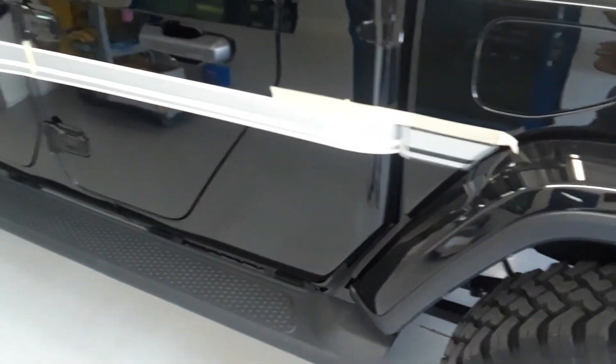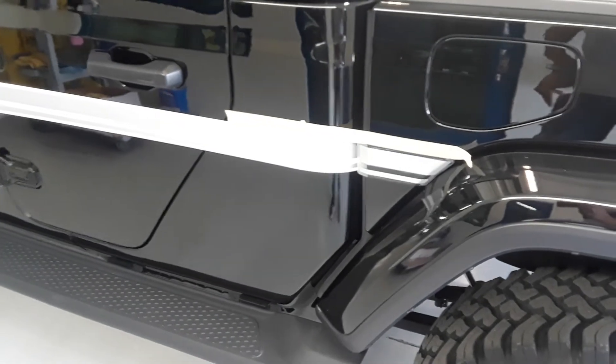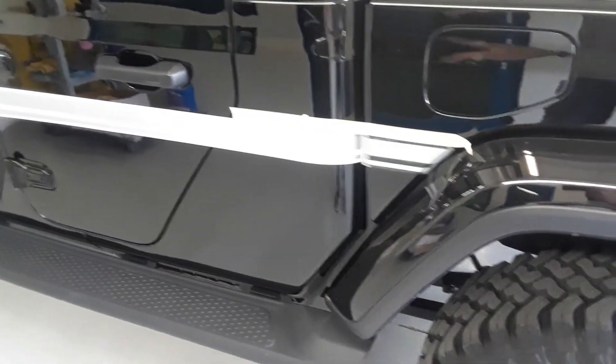There's also a second piece that fits here, and if you're not careful it will go up or down and really take away from the straightness and levelness of your stripe kit. So what we do is take a little piece of masking tape or striping tape and run a straight edge, then use that as our leveling point so that we make that piece line up with the rest of it.